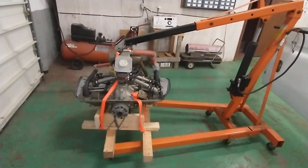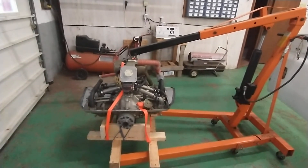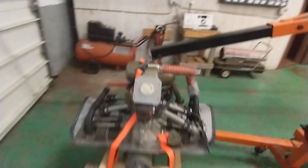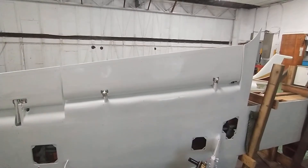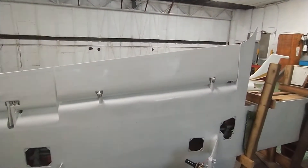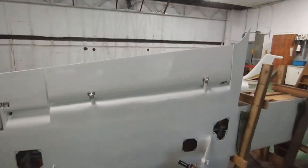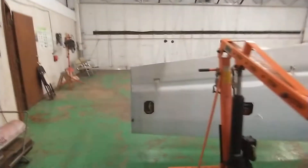Here's the engine - it's upside down right now, but it's a Continental O-200 with high compression pistons, expecting 108 to 110 horsepower, which will be cool. With the ground-adjustable prop we're expecting decent performance. The flaps are actually reflex flaps - they go up about 5 to 10 degrees - which should increase cruise speed by about 15 mph, so that should be really cool.